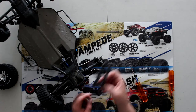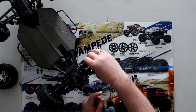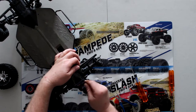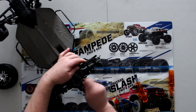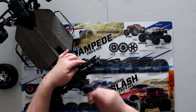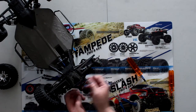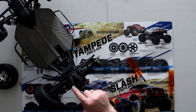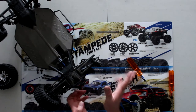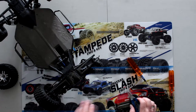Pop the new one in and repeat the steps you just did, but backwards. Put your A-arm in and insert your hinge pin — sometimes they need a little bit of coaxing. Now, this blue bar should not come off; it is screwed in the middle, that's why I did not bother removing it. The hinge pins I can remove without removing that.